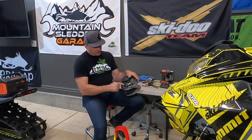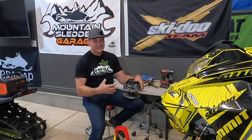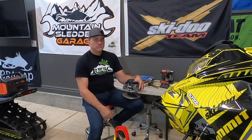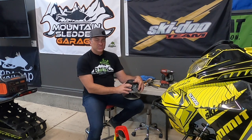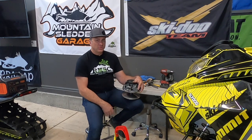There's also some other rollers they call the drive rollers — these little plastic black rollers here on the side of the clutch. We're not going to get into those today because they don't seem to need as much maintenance or wear as much unless you've got four or five thousand miles on your snowmobile. We're just going to go over the flyweight roller maintenance today.